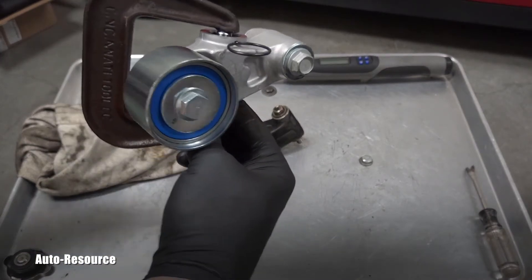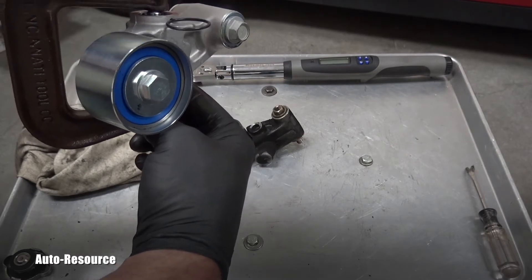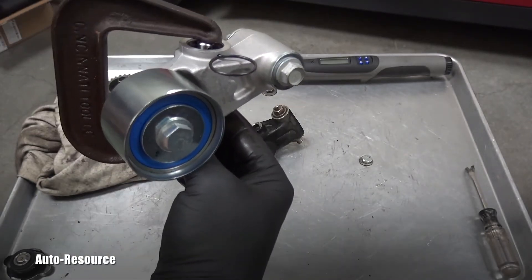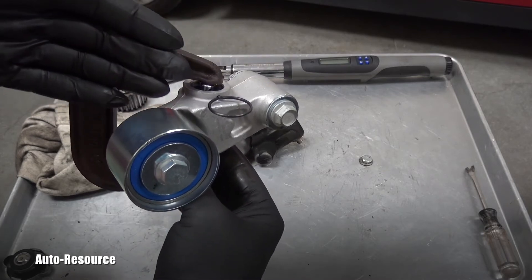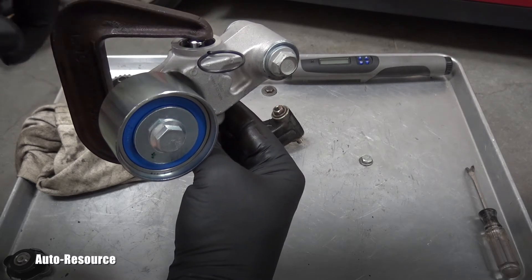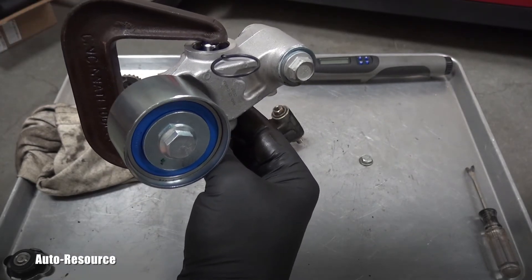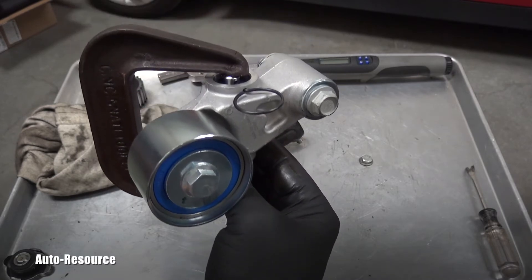What I will be doing right now is putting it in a C-clamp, applying very little pressure on that pin, removing the securing pin, and very slowly releasing it so that the hydraulic pin can go all the way up. They say it has to be so slow that the whole movement — which is not very much — must take no shorter than one minute.